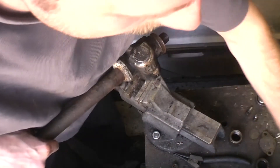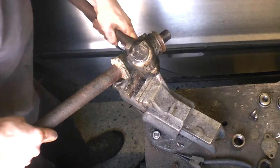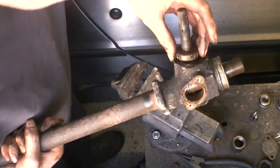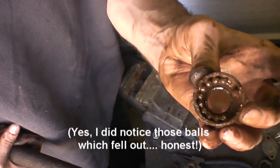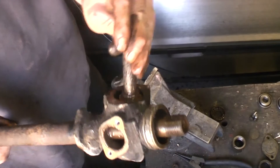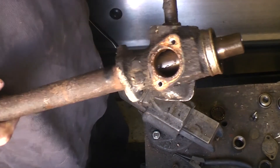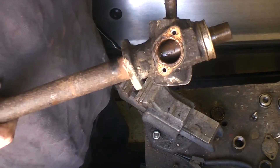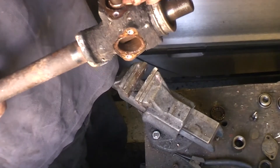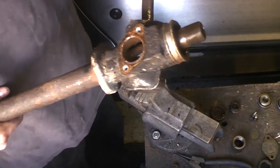With my hammer, she's out. Now check out all those balls in there — open to whatever's inside the rack. Bloody awful design. That's probably about as far as we need to go here. You can actually see the rack going in and out. That pinion has to come out now, but I suspect the inner race on the opposite side is rusted solid to the shaft, which means it can't come past the rack.